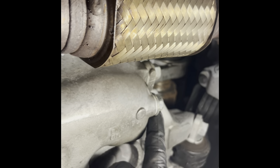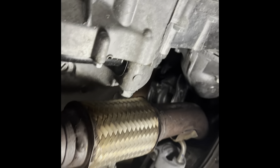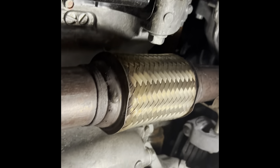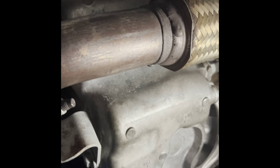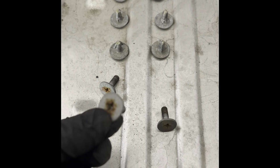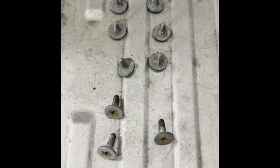Under the CRV, this is the oil change drain bolt right here and there's the oil filter right there. Not that one — that's the CVT one. The correct one is where the oil pan is. The blue filter is where your oil change bolt is. There are a total of nine bolts: three are regular Phillips screws, and six are quick release flathead screwdriver ones. Six plus three equals nine bolts — don't lose them.